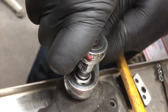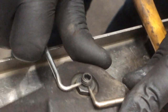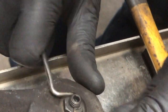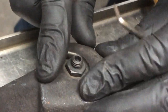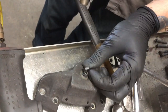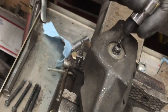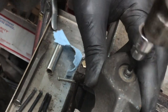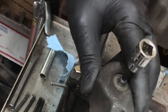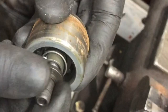Once we're certain the piston is off the adjuster — it may give us some grief — we use a custom vice with slots cut in it so that you can grab the sides of the piston without damaging the top. We'll lightly tap back and forth on the caliper body until the piston lets loose. With the inner piston removed, it's time to turn our attention to the nose section and the outer piston. Here's a pro tip: take the nut and tighten it down so it's off the clip, remove the clip, then remove the 13mm nut from the adjuster. With the nut removed, we simply tap the piston out — this saves wear and tear on that small 4mm adjuster.